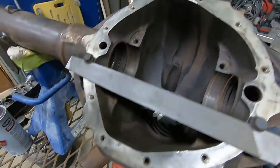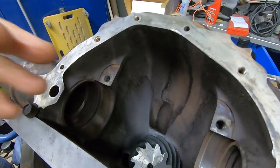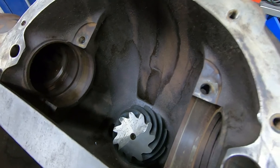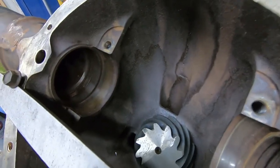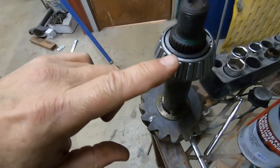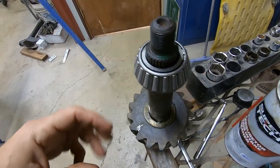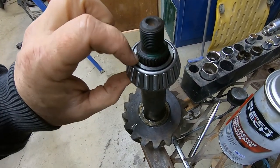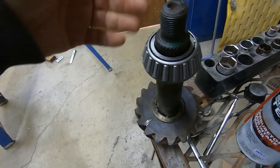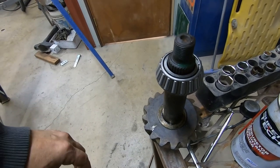My main goal today was just to get this set up to this point. I've driven new races in. I mean, there's lots of videos out on YouTube on how to rebuild a rear end from beginning to end. But you guys understand, every one of these tapered bearings is going to have a race that matches it. And we need to keep them together. That's why I want to use the same brand and part number bearing when I'm doing my setup bearings. The machining tolerances are close enough on these things. They'll go back in and you won't really have any change.